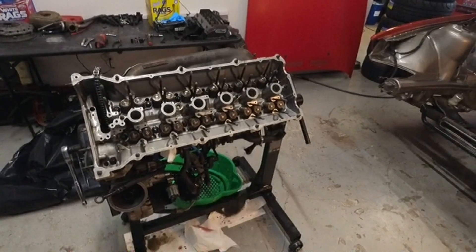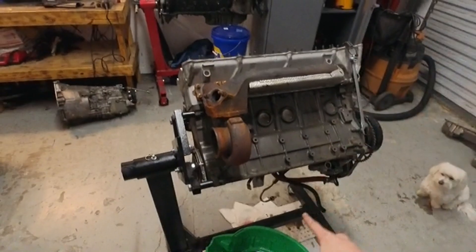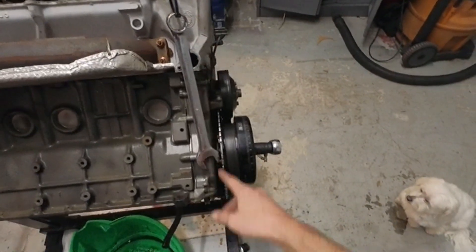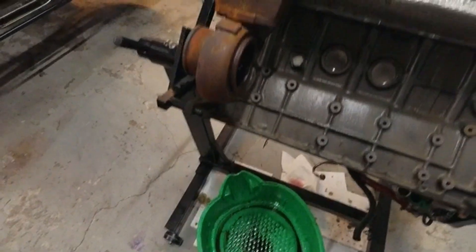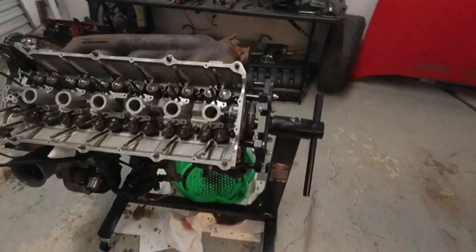So I may skim the head — I'm not even pulling the crank. I know y'all are going to call me crazy, but we've done this before and it works. If it was a customer's build I would heat up and press off the pulley, remove all the assemblies, remove the front timing cover, the oil chain tensioner, remove the pump and the crank, and have it all torn down before re-honing these cylinders. But this is my personal motor and I'm trying to get it done so I can drive in June. I've had one event this year — it was at Mid-Punch on Hosted and I made it three laps before this motor let go. It's been a slow year of planning and building, and it's time to execute.